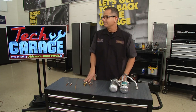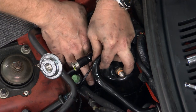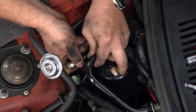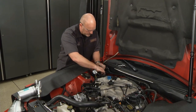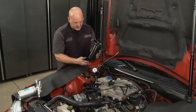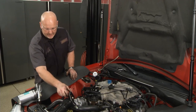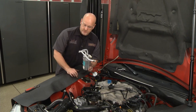All we've got to do now is get these on the car. I've got the accumulator dryer just about out — there's only one strap and one bolt that holds it tight against the firewall. I have a rag down here covering all O-rings and lines to make sure I don't get any debris in there as I pull this up and out. I can feel that there's some debris in the bottom of this thing, so it's clearly in need of replacement. We've taken the low pressure switch from the old one and reinstalled it on our new accumulator dryer.